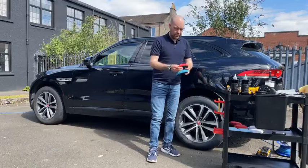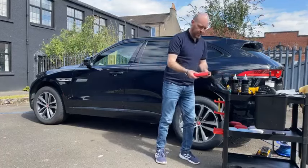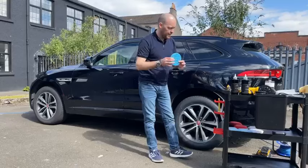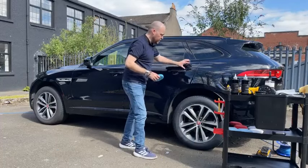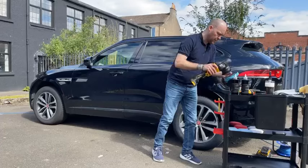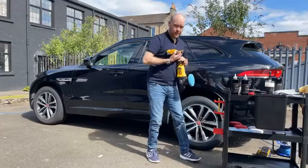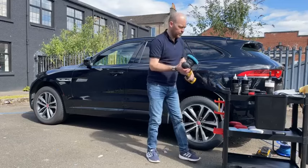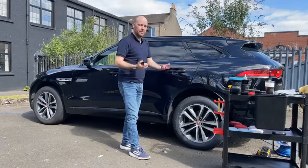I've got a variety of finishing pads here — various levels of softness. This blue finishing pad, the red and gray are pretty similar. I want something with a bit more bounce back because Pure has some micro abrasives, and I want to make sure the paintwork is totally clean before we start. Just make sure the pad's centered. I've got another 18-volt battery on charge — I've been told they last about 45 minutes, so we should be done by then.